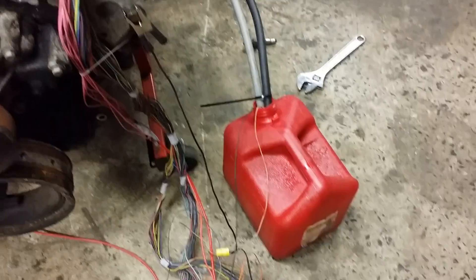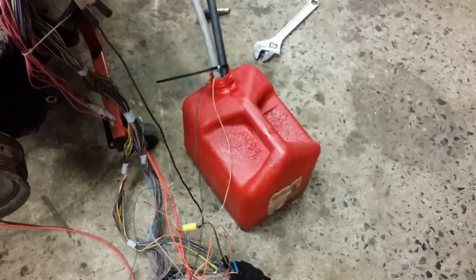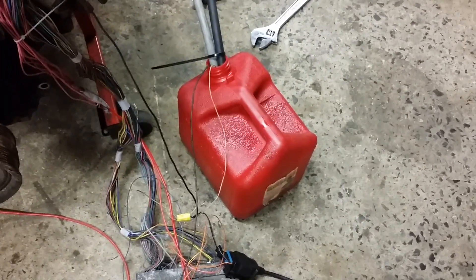What's also funny is this fuel pump I have, I thought was good, is not that great, but good somewhat. It runs 20 pounds of fuel pressure wide open, so we compensated in the tune.